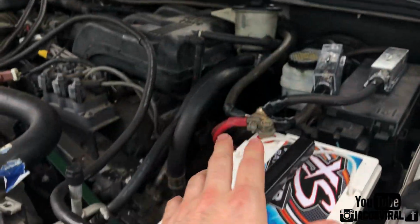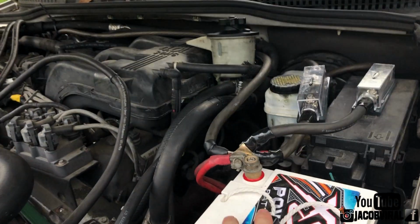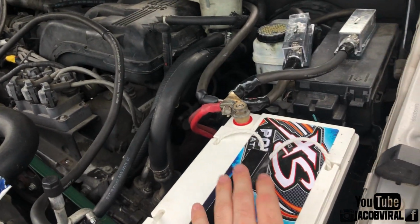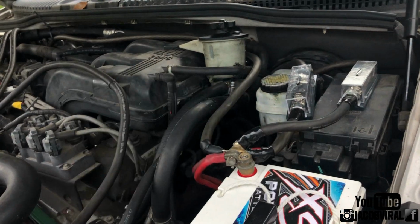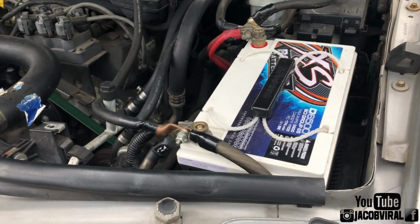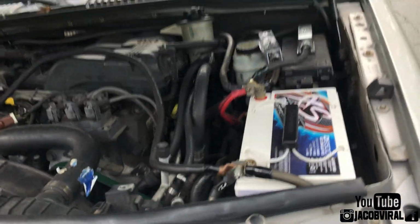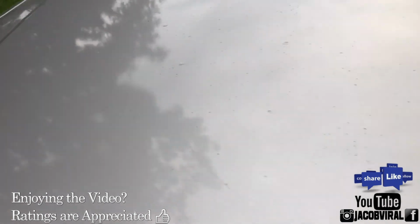So, to end this in summary before I end: if you're looking at upgrading your batteries and don't know what to decide on, look at how much your RMS wattage rating of your amp is, and divide that by 10. So if you have a 2,000 watt amp, you're going to need 200 amp hours of battery reserve. And then of course you can account some of that for the alternator, like I mentioned. That's the way I did it. It's probably wrong, but it's worked for me in my past systems for the past 6 years, no issues.